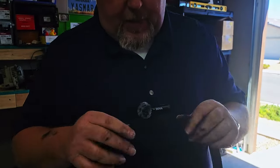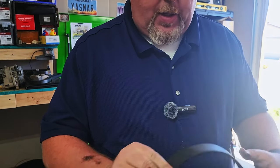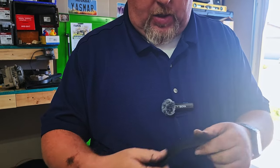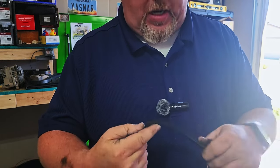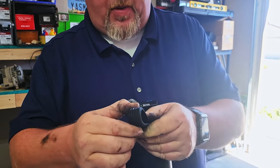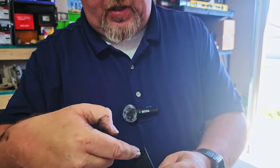Examining the belt that came off: the backside is worn very thin and gritty, which means it is starting to come apart — this was definitely a good time to replace it. Looking at the belt itself, it's starting to crack in multiple different areas.